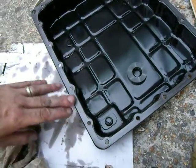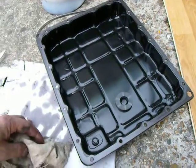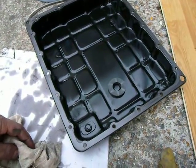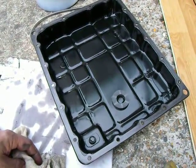What I'm going to do now is get all the little screws with their washers and clean them all off to make sure there's no gunge on the thread, then put a little bit of Loctite on each one and do them up, and we should be sorted. It's just a matter of putting the oil back in.